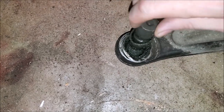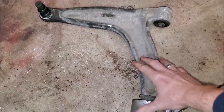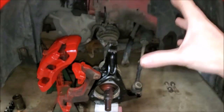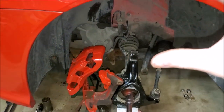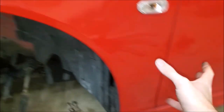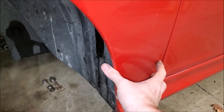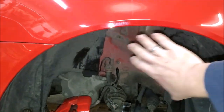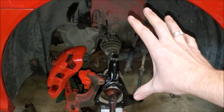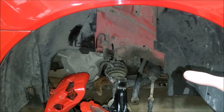Actually, a really bad ball joint. It did still have the dust boot on it. I took it off to examine it further to see if it's something I could press out. Unfortunately, that is not the case — you actually have to replace the entire control arm. But believe it or not, these are priced reasonably for being a Saab. While doing this process, I realized I want to rust-proof inside this fender liner, because I live in a rust belt state. It's a very common issue for crap to accumulate here and eventually rust from the inside out on this fender.